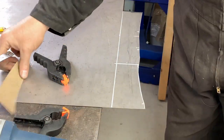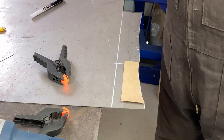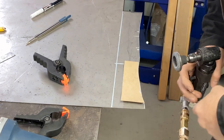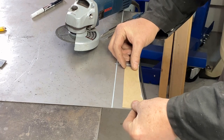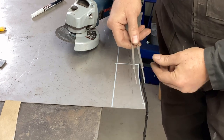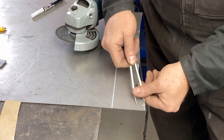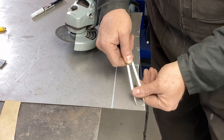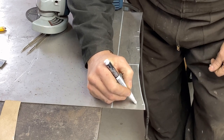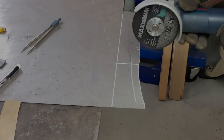With the rough shape in place, just a little cleanup — because that edge is so important as the basis for the contour line, you want it to be bang on. That edge is now cleaned up perfectly to my traced profile. I'm going to take my caliper and measure in from that edge three-quarters of an inch, which gives me a little bit of play on that top lip to the center of the bead roll. I'm marking a nice bright white line following my scribe so I can see it when I'm at the bead roller.